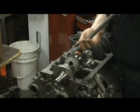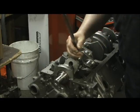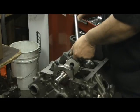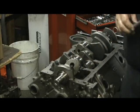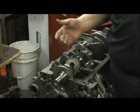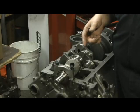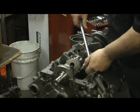Now we're going to discuss what zero deck is about. The reason this process is so important is because you gain two, maybe three major things out of it. Number one: by having it at zero deck you get quench, which only occurs at 40 thousandths and below. I typically like to see it around 35 to 38 thousandths total, which includes the gasket thickness. So if you're at zero deck and you use a Felpro 1003 gasket at 39 thousandths, you're right in the game. That turbulent movement of gas makes all the difference in the world.